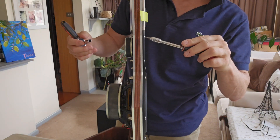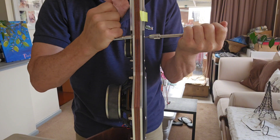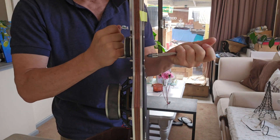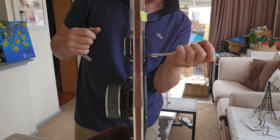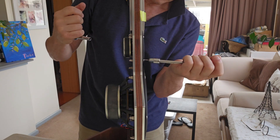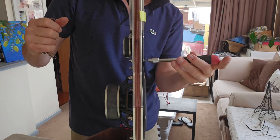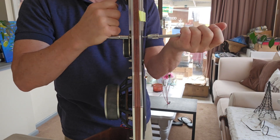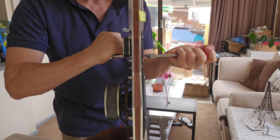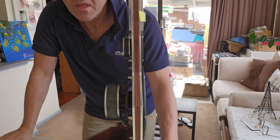Move up to the upper mid-range. I usually cross them over so I do the opposing side as the next one on four, just to spread the weight nice and evenly, then the other cross-hatch from top to bottom — just to make sure we're spreading the load out across the driver onto the baffle evenly. They've all got Loctite on their threads. We'll check them all one more time and make sure we're happy with the tightness — all the drivers are tightened up.